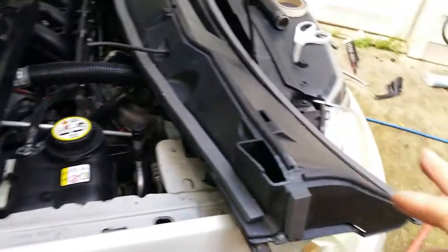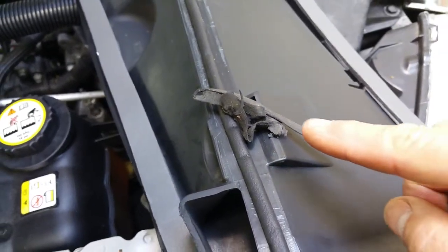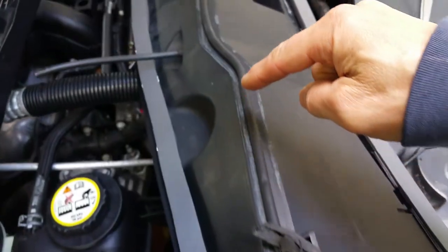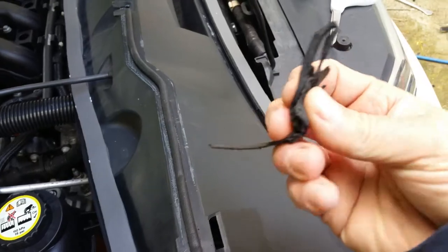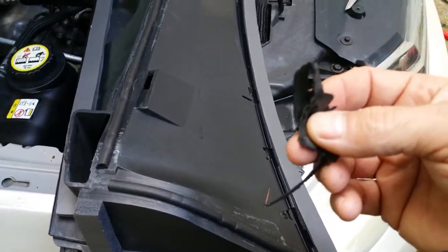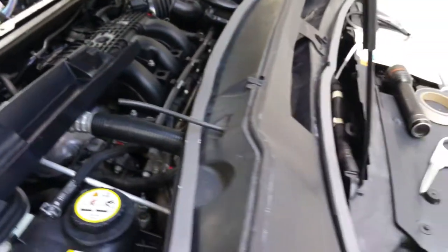The black cowling that's usually in the lower part — that black cowling with all these vents — I've got it flipped upside down right now. All of the original weather stripping that was on it was completely flattened. Here's what came off of it. All this is weather stripping, and it had various thicknesses all around the perimeter and all across the center, but it's obviously pointless now — it's all flattened. That's one reason why so much debris can find its way down beneath it and into these chambers.